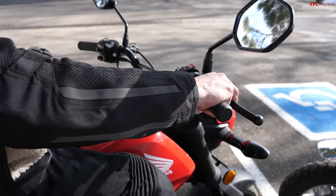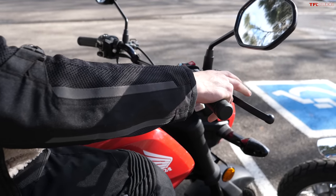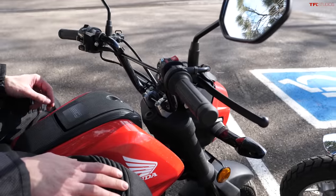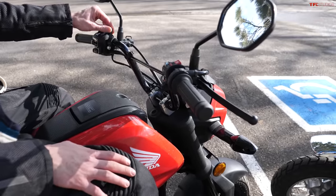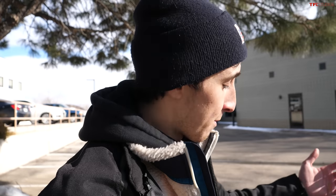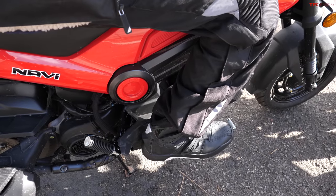You've got to have the brake pulled in too. Start it up — no problem, revving up no problem — but you do have to let it get a little warm. It's not that cold out today so I can throw the choke off right away and the bike won't have any issues, but on a really cold day like in Moab you definitely need to let it sit and run for a few minutes with the choke on. It sounds like it's gonna die, but it's a Honda — it's not gonna die.